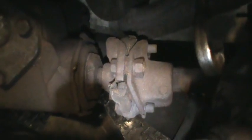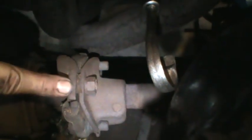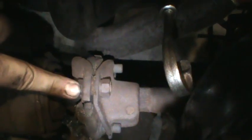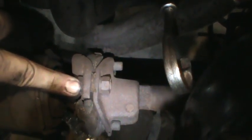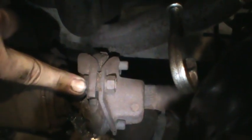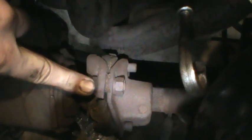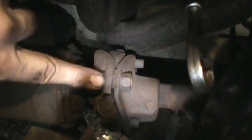I'm thinking of actually disconnecting it in all three places. There's a pinch joint over here that goes on to the steering box, and there's also a pinch joint that goes into the steering shaft, and then there's the rag joint itself. Disconnecting all three means whichever one is easiest to separate will separate when I pull the steering column. It's only four bolts total.